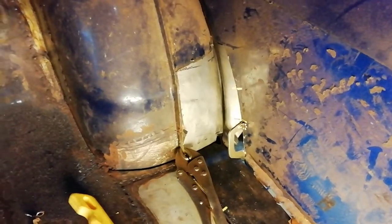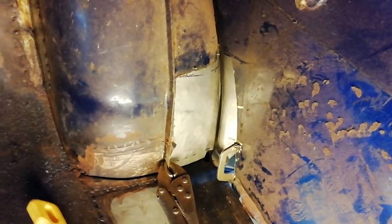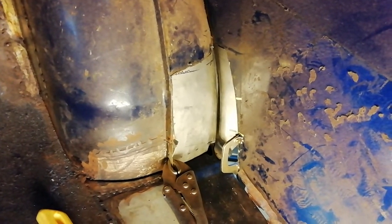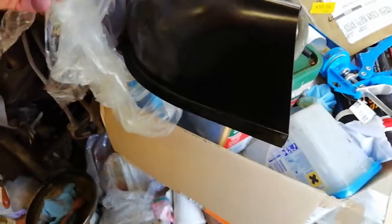Today's wonderful fun, and the last few days, has been sorting out this side of the boot floor, which is simpler — no spare wheel well. It needs part of that inner wing doing, as well as a bit of inner wheel arch and outer wheel arch as well. I do own a complete rear wheel arch repair, but as it costs 100 quid and I'm only going to use about a fifth of it, it seems a bit silly. So I've been tapping away with various hammers and I've made a replacement for it.